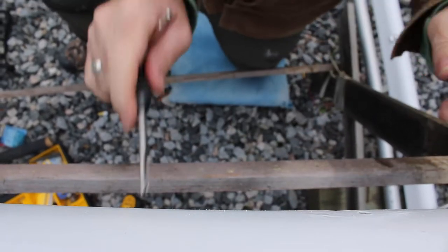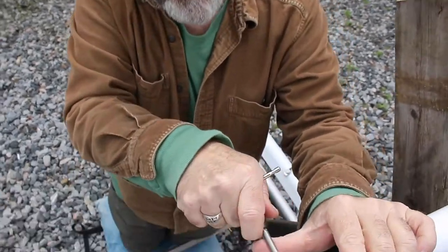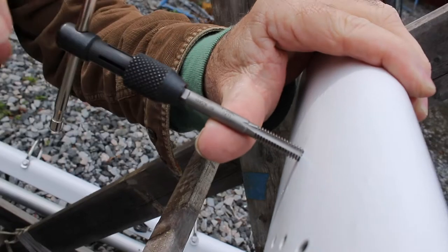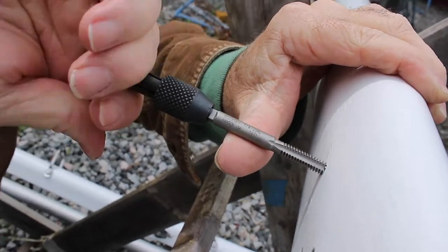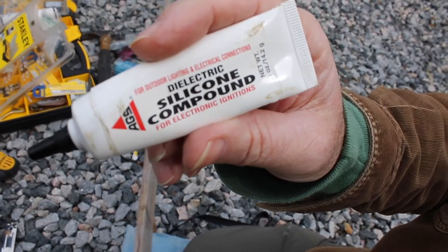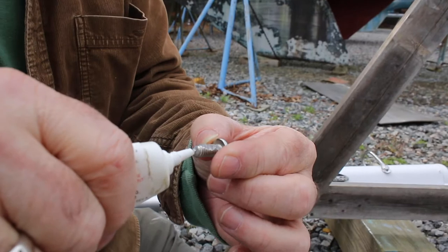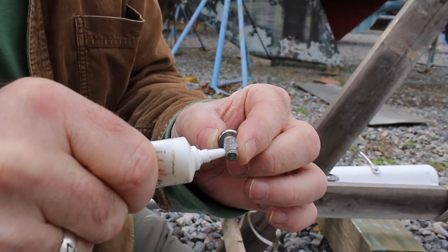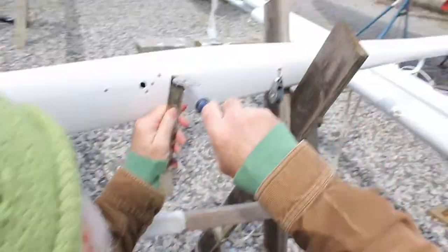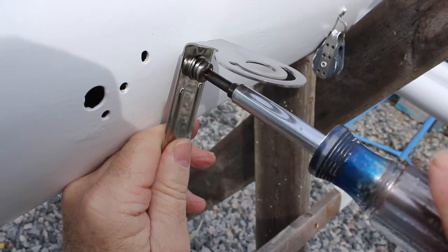Whenever using dissimilar metals together, especially for fasteners, you should always use a galvanic isolator like dielectric grease or Tef-Gel. I used a dielectric grease here, but it was a perfect situation for the Tef-Gel. I really wish I'd have used it. It's great stuff. We even had some on the boat that I found later. But the dielectric grease will work well too.